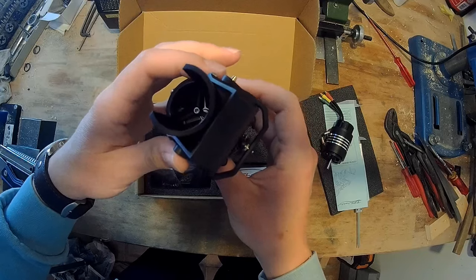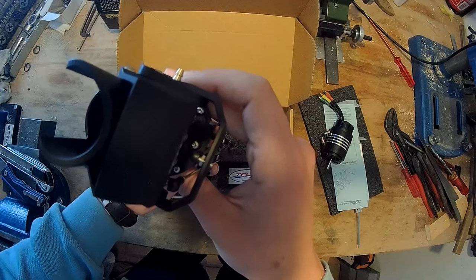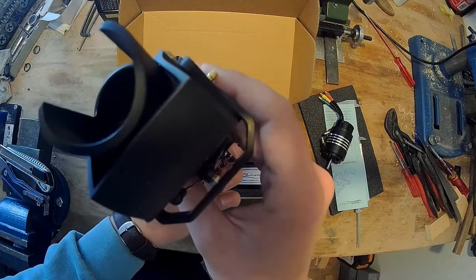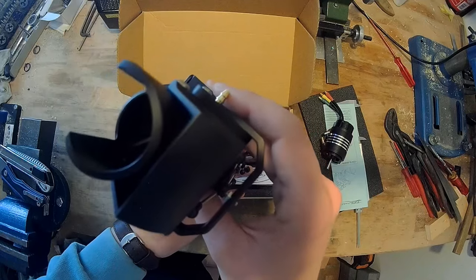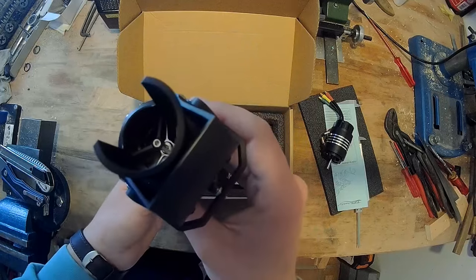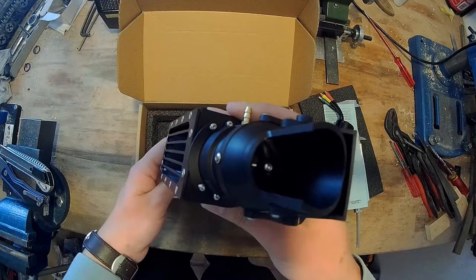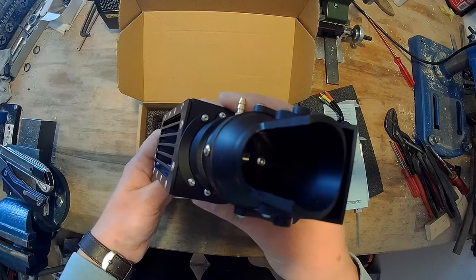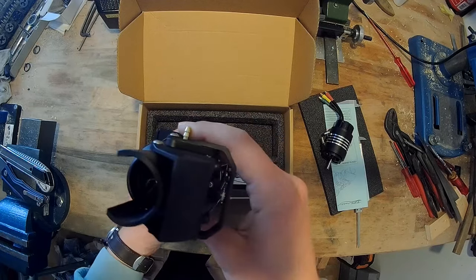Yeah, so here we can see the different jet parts. We have the impeller, a four-bladed impeller with overlapping blades, also CNC machined and actually replaceable, of course. But from my experience, you don't have to replace them all that often. You can actually just sharpen the blades, and they will work for a long time if you sharpen them every, I don't know, 10 runs or so.